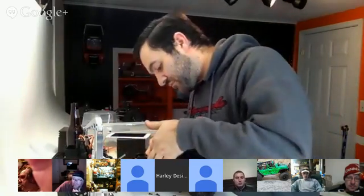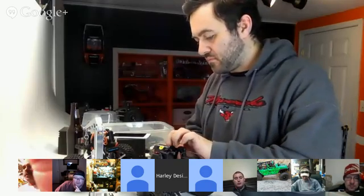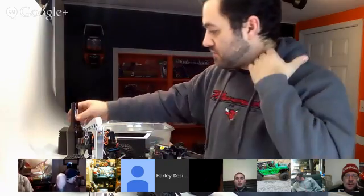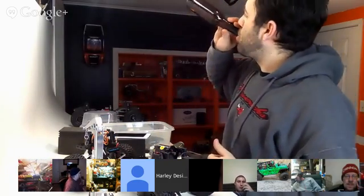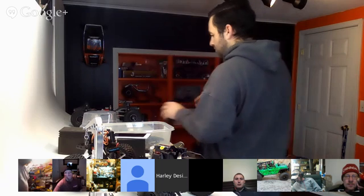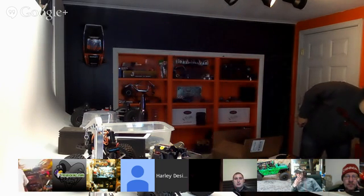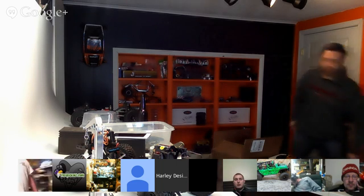Okay. So, do you like the Rock 412 motor? I love that motor. It's a great motor. The issue is I bought two of the 30-turn Tekins, and I literally get 3 hours out of them, and the brushes are gone. Tekin has both of them right now to see if there was some kind of issue, but they said there's no issue with the motor, but I burned through two of them at 3 hours each of runtime. And same truck, I assume.